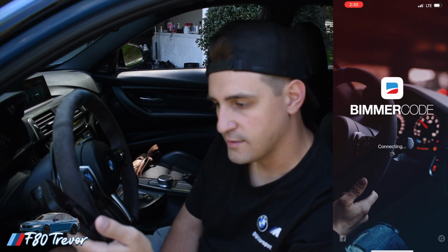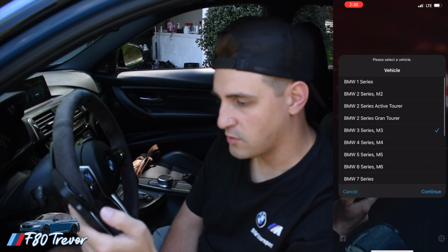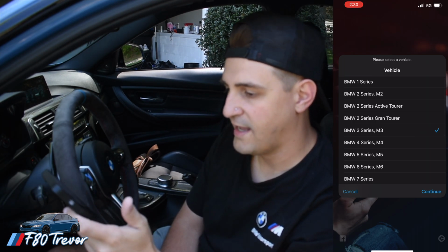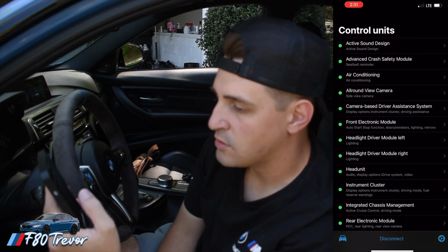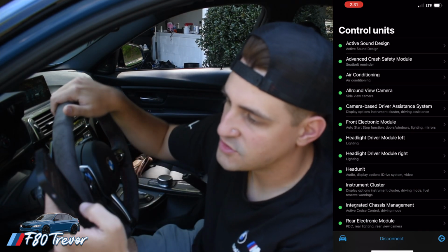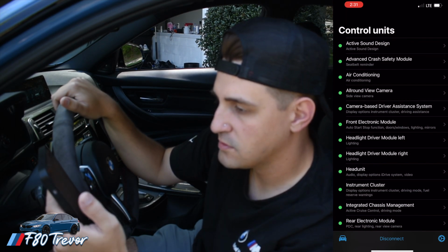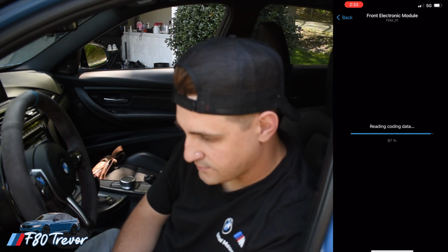hit connect. It's going to ask you what your vehicle is. Mine's a BMW 3 Series M3, so click that and hit continue. Okay, so we are in the control units. From here you are going to want to scroll down and find front electronic module. Click on that. It's going to read the coding data for a little bit. We are at 97%.